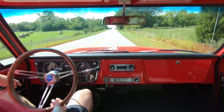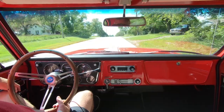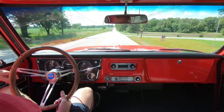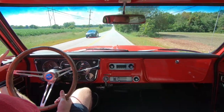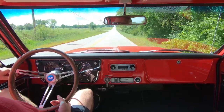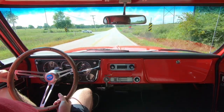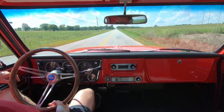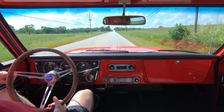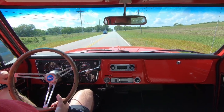There was three-four and lockup, so it kind of did it all in one combo. I'm actually going to get HP Tuners one of these days and just tinker with it for my driving style, because my lockup I think is too low — I don't want it to lock up in third gear driving around town, it just doesn't need it. I don't have the rear C-notch in here, so if you hit a big enough dip the rear end kisses the frame.